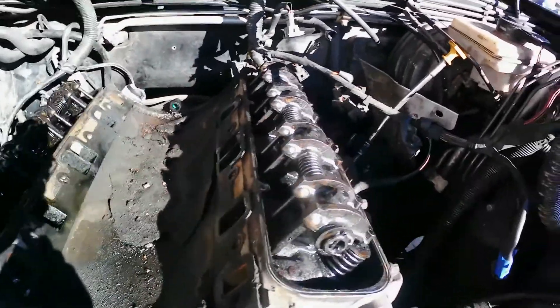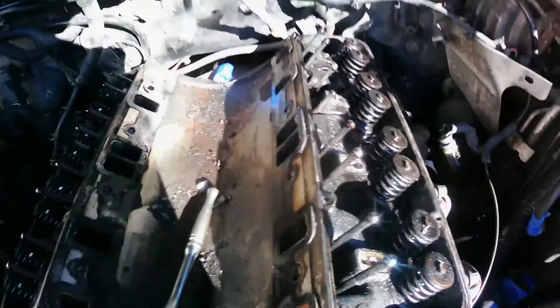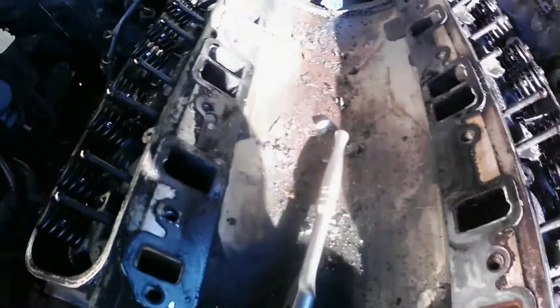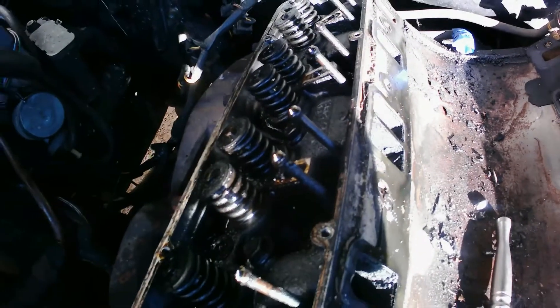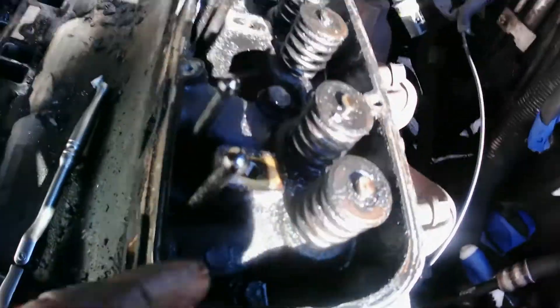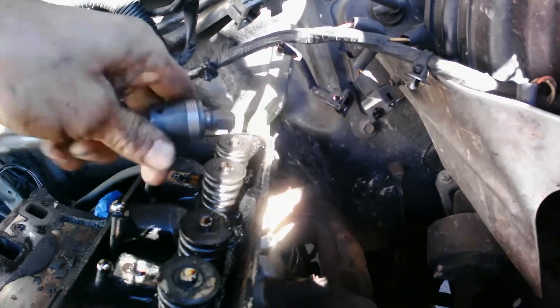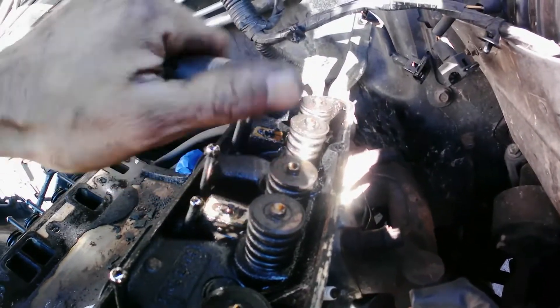As you can see, when you don't change your oil when you're supposed to, that's what happens. I got that removed now. I think a blower would help but I think it could be better if I do my cleaning job too. There's a loose part right there — I need to get it clean inside the engine because it is bad already. Then I'm gonna start with the heads. There's a bolt back there that you're gonna have to use a universal joint to get; the rest you can get normally but that one is complicated.